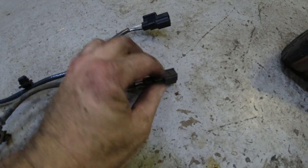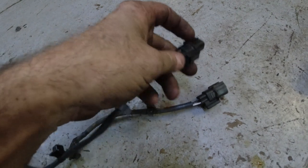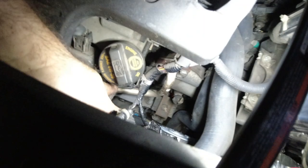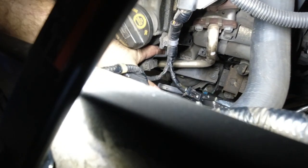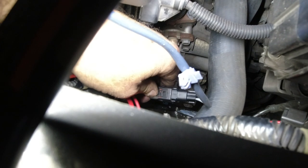Also, the connector — I broke the connector because I couldn't figure out how to get the thing off. It actually comes off on the top. I was prying on this piece and it would not come off. This piece here releases it off the bracket — there's a bracket right here with a little tab, and this goes up like this and hits the tab. The connector is right here: all you have to do is press down on this piece where my thumb is and then pull it, and it will disconnect.